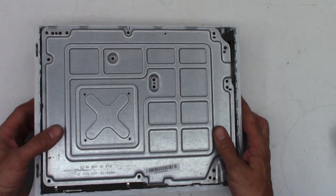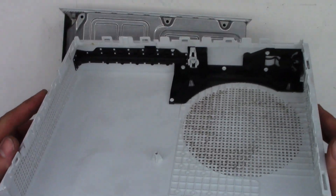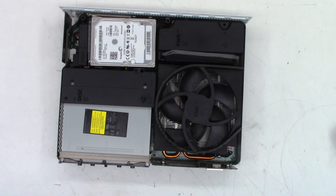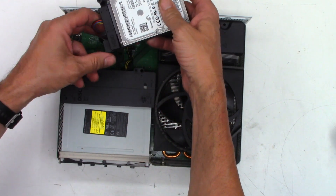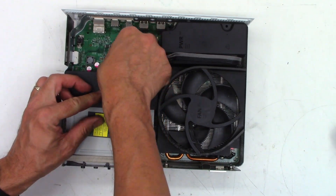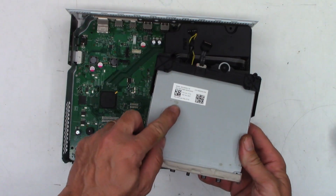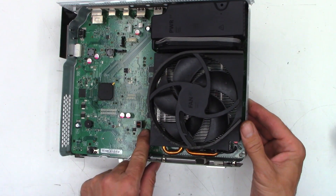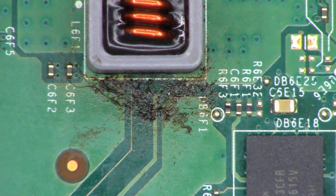Let's just go ahead and look and see what we have inside. I don't really see any liquid damage on this side. There's a tiny little drop on the bottom of the DVD player, and I certainly see some corrosion going on here. Let's zoom in on it. There's the stain from the top side of the board at least. It doesn't look too terribly bad. Should be able to be cleaned up quite easily. That's the only defect I can see on the top side of the board.